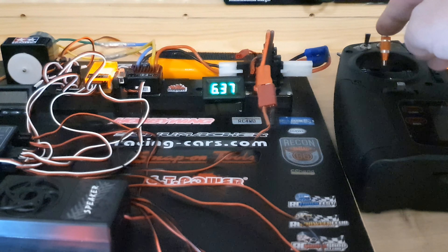Here we have it all fitted together with my usual tape on the lights to keep the wiring tidy. It was a little misleading at first because on the instructions it says black, red, and white — so I plugged in black, red, and white with white at the bottom. But I missed that the line went to the top — the white signal wires on this side go into the top, and on the other side all the power wires go towards the top.